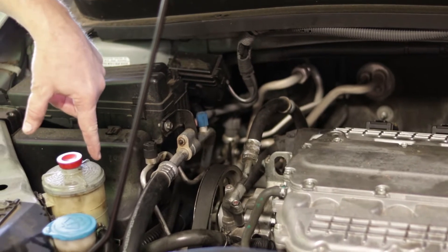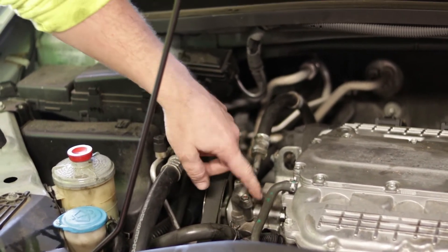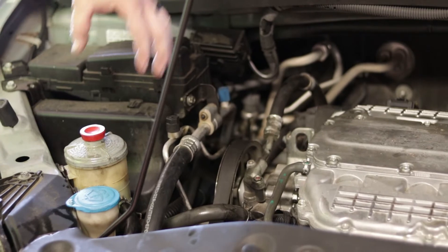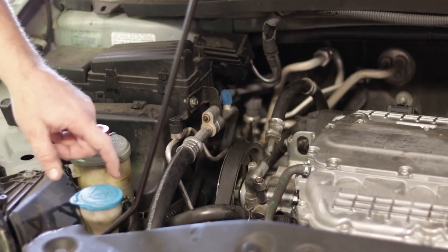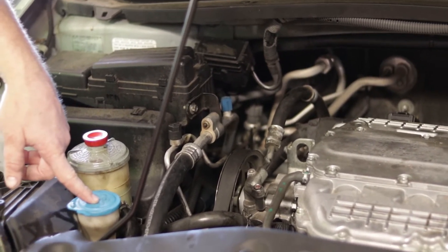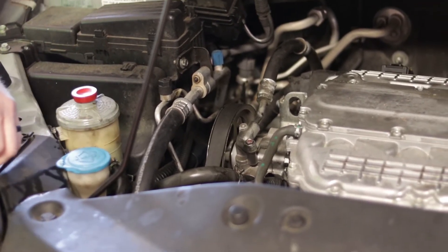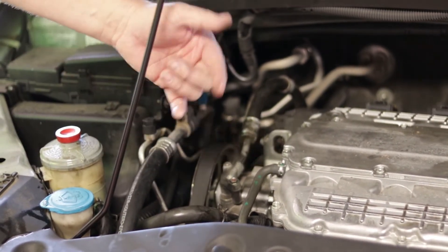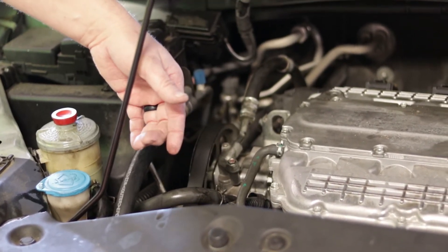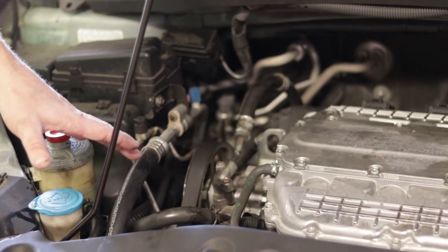So what we're going to do — you're going to take your power steering fluid overflow off by taking this hose off of the power steering pump and taking the hose off of the reservoir. There's a bracket right here you're going to take off because those bolts are going to get in the way. I've also seen videos where people tell you to take out your windshield wiper fluid canister — you don't have to take it out, just loosen the bolt so you can move it to the side. Once you get your belt off and undo the two bolts holding the alternator on, unplug the plug on the back and take off the cable that goes from the alternator to your fuse box, and your alternator is going to be free to move around.